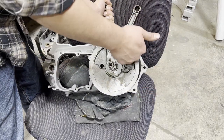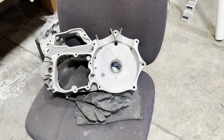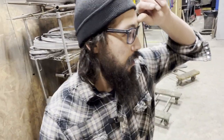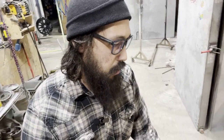That part will be a tomorrow project. The crank bearing — the sprocket shaft bearing — is back installed. Can't do anything until I finish cleaning up and degreasing the crank; it's been bumping around in the back of my car which also has a bunch of sand. The outside of the crank has oil residue and oil and sand like to stick together really bad, so a ton of degreaser and cleaning to do on that before we put the crank back into the cases. That'll probably be tomorrow morning. Crank races are in; now we can go to the other side of the case and set up some cam bearings.